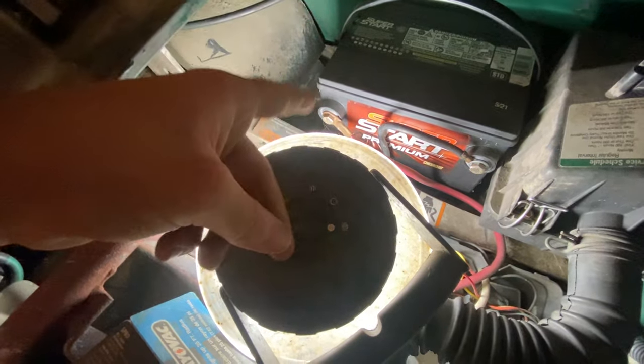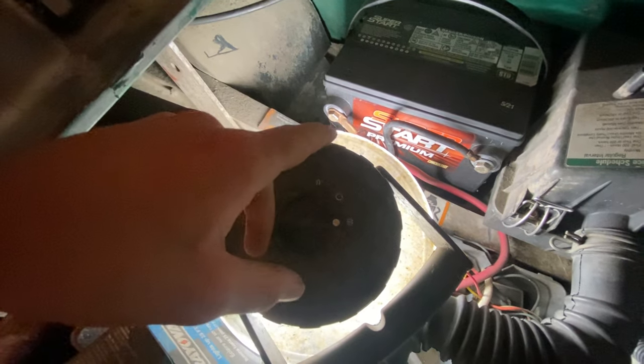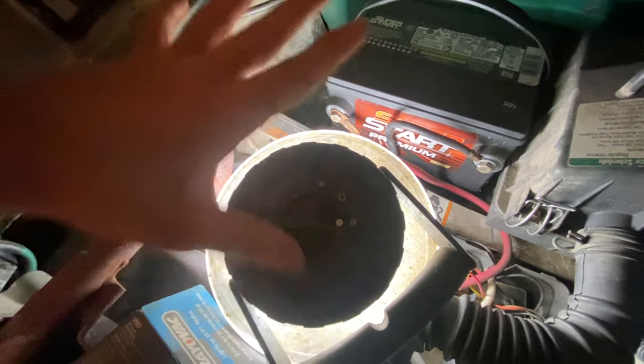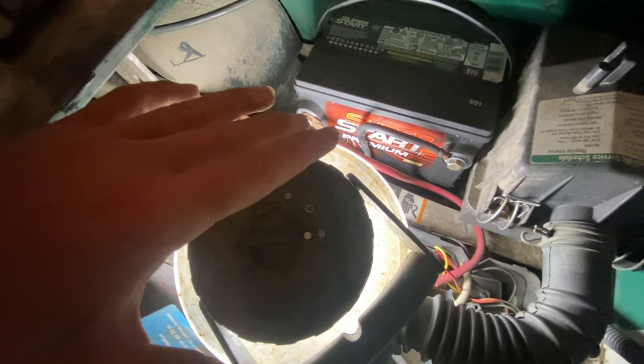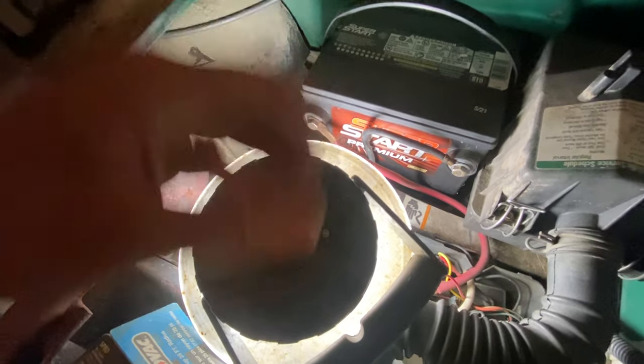But if you charge your battery or you put in a new battery and the same thing happens again once you have it running and it just stops working, it's your generator. So basically you need to fix the generator in your golf cart, because your generator is bad. There's no point spending $120 every week because your battery is going bad. But for the most part, guys, on gas golf carts, that's about the only thing that's really going to be stopping you.